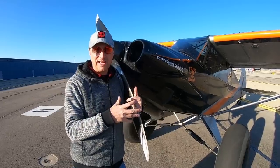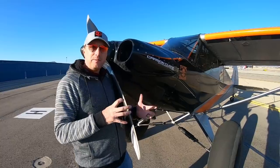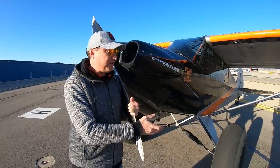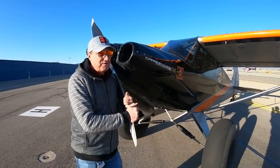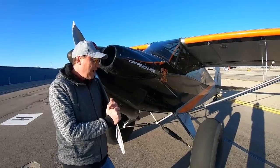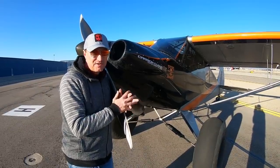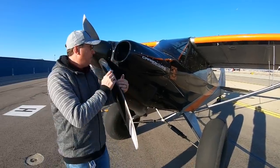Be aware when you're using your brakes a lot or doing tight pivot turns — you're twisting off a lot of rubber. If you know how to properly manage tire wear they'll last a lot longer. With the amount of flying I do, I usually get about a year and a half to two years out of a set of brand new bush wheels. Hopefully that answers your question. Back to the walk-around.